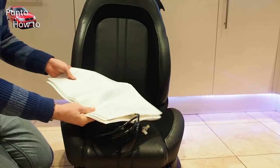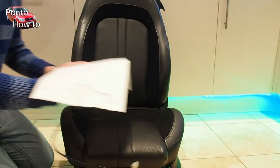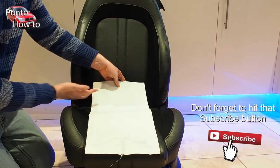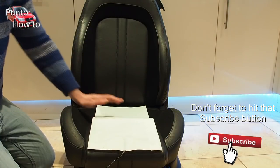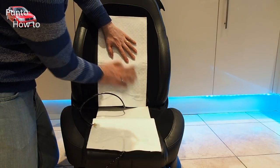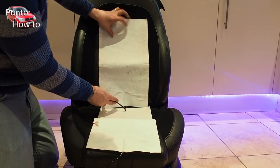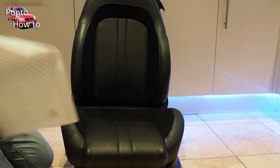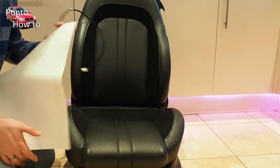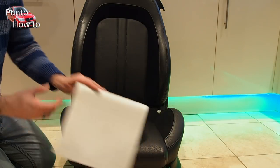Here's the seat out of the car and here are the heating pads. We're going to put one pad in the bottom and one on the back. We just lay the pads out on top of the cushions to begin with. There's a bit of excess at the back which we'll trim off with scissors. The back of the seat pad stands a bit tall so we're going to have to trim the top part off, but they should go in quite nicely on these particular seats. You'll notice there's a line of stitching down the middle of the seat — this is just in the leather fabric and shouldn't cause any problems when we put the heating pads in.